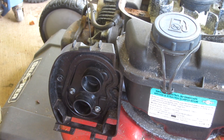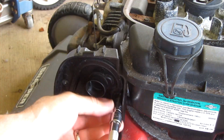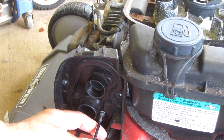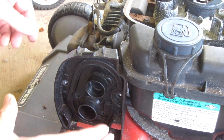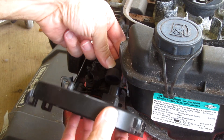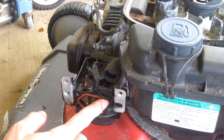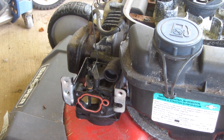The other two are T15 Torx screws. I much prefer the Torx bit screwdriver if you have one, otherwise just put an adapter on your ratchet. When this cover comes off, there's an air intake hose on the back side and it just simply pulls off — no nothing at all, it's just a friction fit. You should check and see if you've got this red seal here. Sometimes it may come off on the back side of this adapter, so just make sure it's there and not all ripped up.